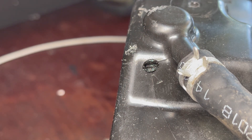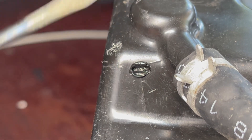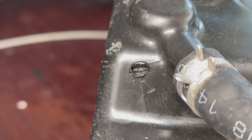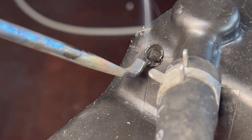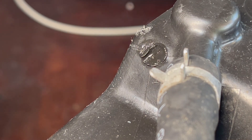As you can see, we've made that valley. We haven't punctured through the tank — if you've got a very thin tank it can be easy to puncture through. What that valley has achieved is it's actually melted the hole that's gone through the tank. I'm not just covering over the surface, which could then crack again really easily — I've melted that whole section. Now we'll reheat the screwdriver, press that plastic on the outside back in, smooth it back off, and really fill that back up.